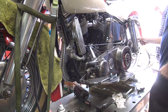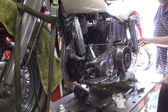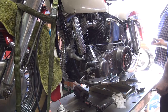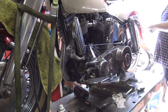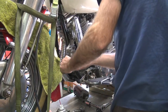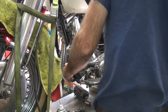The cylinder was leaking quite a bit. I put the washer in there - you shouldn't have to have the washers, but I decided I'm just going to get in there and triple up. I had to put a longer banjo in it - this is the original banjo here, which is a quarter inch shorter. So this is all tight - no leaks at all. The wheel is done here, you can spin it. So we've got all that working. These zerks all need to be lubricated because they haven't had any lubrication - seat posts are dry.